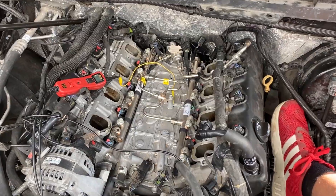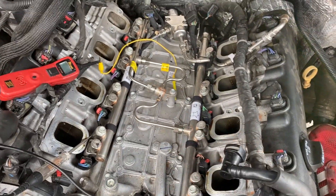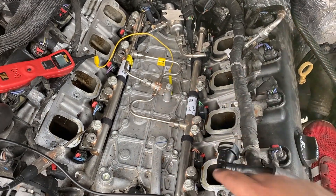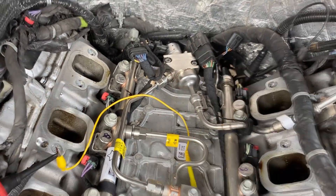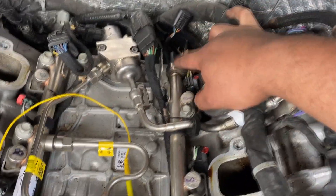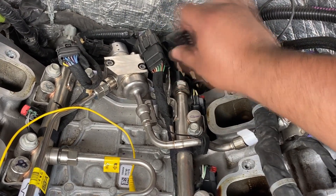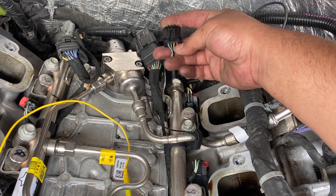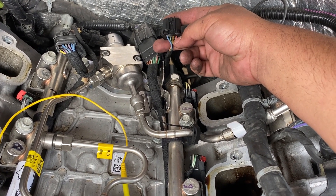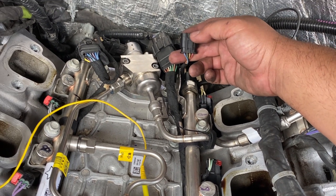They went ahead and took off the intake manifold so I could check it. Here we're looking at the 5.3 liter V8. Because it's a 2016, this engine does have the GDI design, so this is a GDI fuel rail. You can see this is the high-pressure fuel pump right here. We had codes pertaining to the fuel rail pressure sensor, which is located right here — I have it disconnected. I'm going to check the 5-volt reference on this brown and red wire, and the ground on this black and green wire.